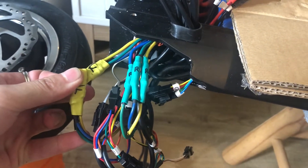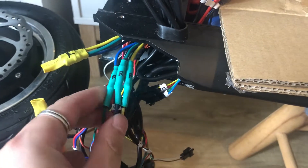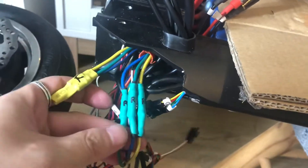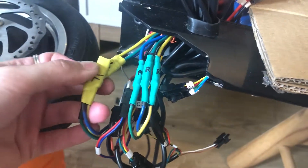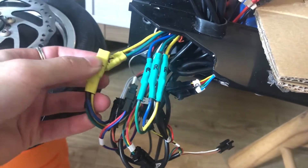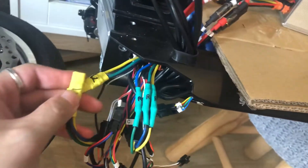Because you have a front and rear motor you have two sets like this, and you can actually swap the corresponding cables around. This is how the setup should normally be — I've labeled them F for front and R for rear. Right now the rear motor is spinning and the front motor is not. When both are connected correctly, both front and rear motors should be spinning, however right now we have motor controller failure.